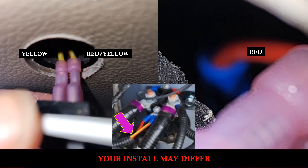I started by tracing wires and testing a couple of fuses along the way and ended up under the steering wheel. Unfortunately it took me that long before it dawned on me that I should have just started behind the emergency switch to begin with. There I found my wires, but they weren't connected in the way that I thought — the yellow and red-yellow went to the switch, and the red wire went off somewhere else. I guessed that it went off to the controller for the slides, but the red and red-yellow wires were the ones bound together on the original setup — those are the ones I thought I would find at the emergency switch.